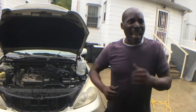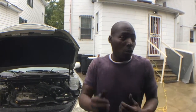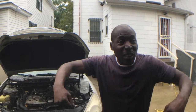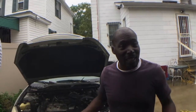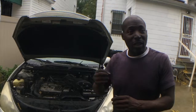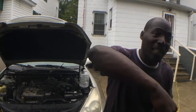Those blow-by gases be trapped inside of your oil case. You understand what I'm saying? You don't want that to stay down there in your oil case, because it's going to blow the seal around your oil pan. So they created what they call a positive crankcase ventilation. What that does is it opens and closes when the crankcase starts building a certain amount of pressure. It opens up and releases it. It sends them gases back into the top of your engine.